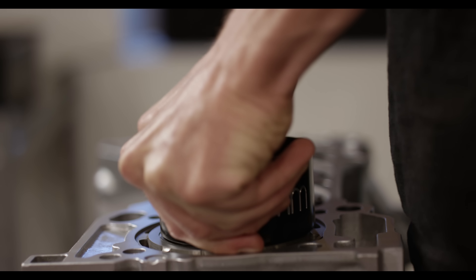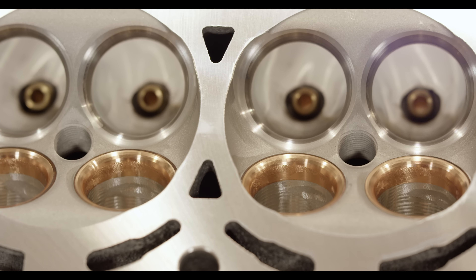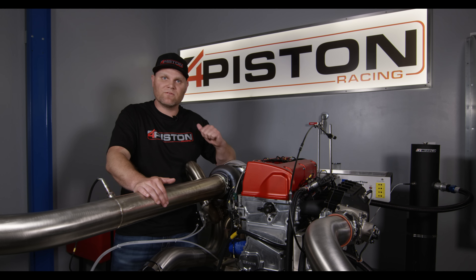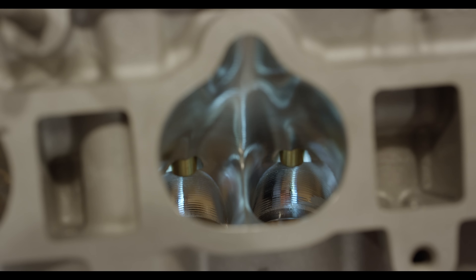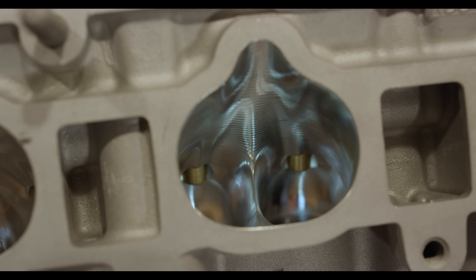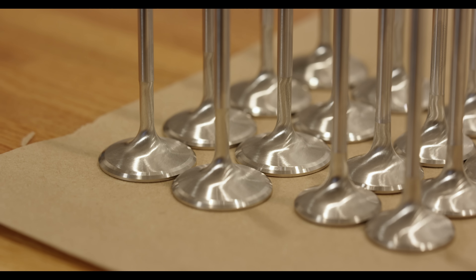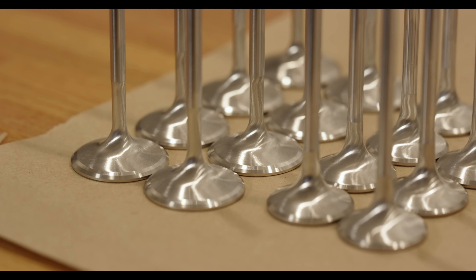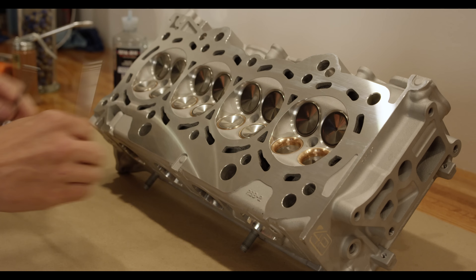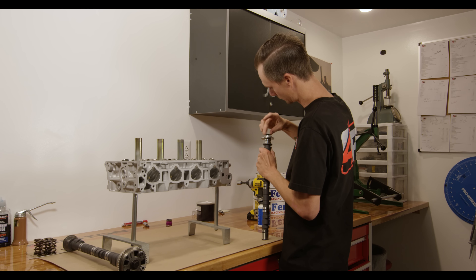On top of this block is a Four Piston Pro TSX CNC cylinder head. It's not a big giant drag race port — this is a port size specifically for these turbo engines so that they're responsive, so that on gear changes they come back into boost real fast and stay in the efficiency range of the turbo. It also has Ferrea valve springs, titanium retainers, and Ferrea super alloy high-temp valves to handle the extreme exhaust temperatures that come with these big turbocharged engines at big boost.